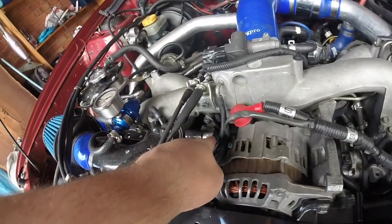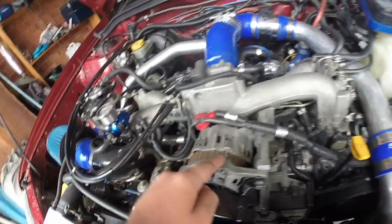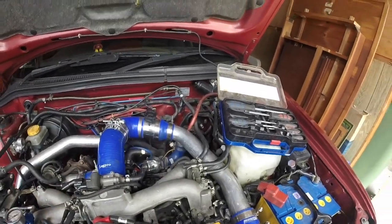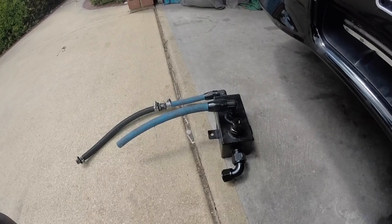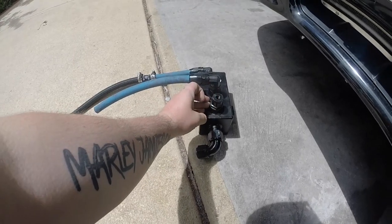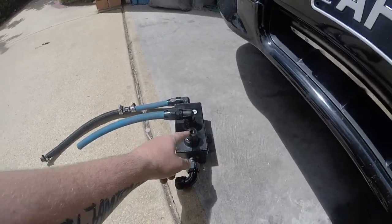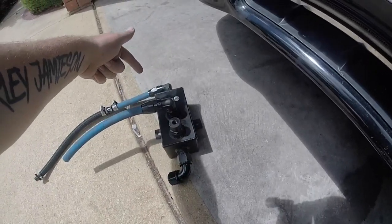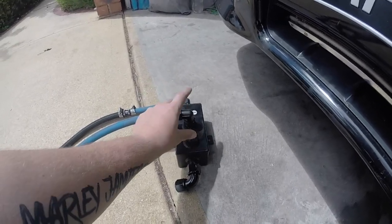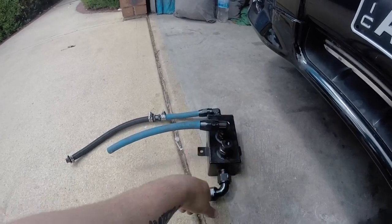I also had this one open. So let's get a hose on there and we'll set up the catch can over there. I'm going to change over these — I'm going to put that plug on the bottom again. These two are going to be for the valve covers, and this will be to the intake, so we've got vacuum coming through.